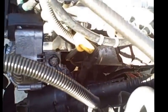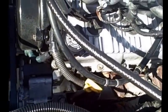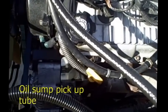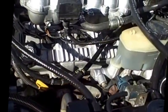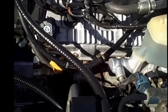The other thing you're going to have to do is take your old hole and just plug it up. I just used a bolt, I can't remember which one, bolted it and Loctited it in, and it was pretty good. The other thing I want to remind you, stepping back a little bit about your oil pan, is you're going to need to pick up your oil baffle for the inside. Yes, there's a modification lesson out there on Yota Tech that tells you how to modify your old one, but I just went ahead and picked up a baffle from Off-Road Specialties and took it like that.